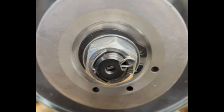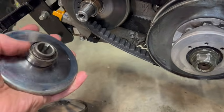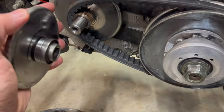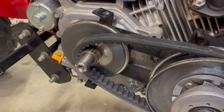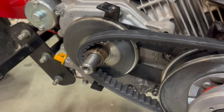This is what I did on another mini bike. I ran into a problem with this Trailmaster driver pulley that has these ball bearing idlers — for some reason it wouldn't shift fully into high gear. Thanks to Tim Salvino for guiding me to use this standard Comet driver with the brass bushing. It works a lot better.